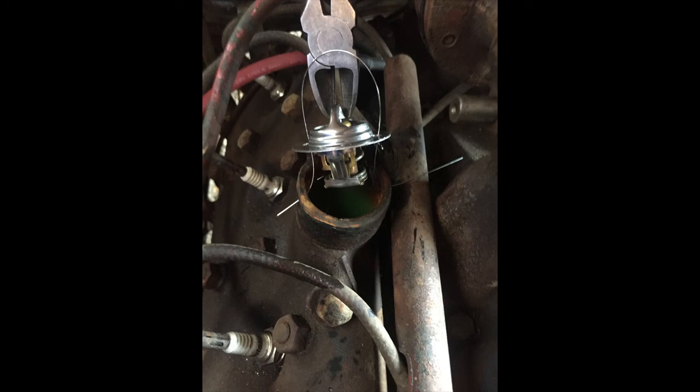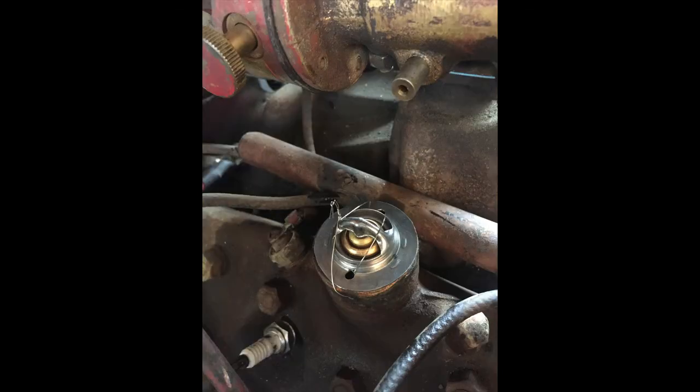Here's the way to route the wire so that it does not interfere with the bulb on the thermostat or interfere with the spring operation. Here's a view of the final install with the thermostat wired down — the vent holes are visible and ready for the hose to slip back over top and clamp it down below the place where you drilled the hole in the water neck.